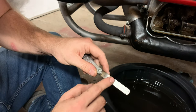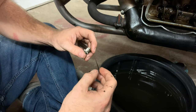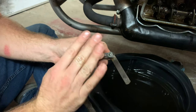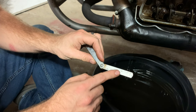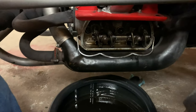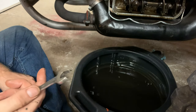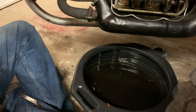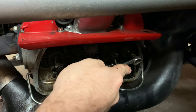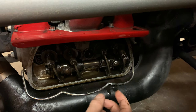They build oxidation on them and it gets thicker. We're talking about four one-thousandths of an inch right here, so you can see how flimsy that is. If it has a layer of rust on it, the entire measurement is botched. This one's actually not too bad — it's pretty clean, so we should be pretty good. If you had a Brillo pad you could smooth them up, but the problem with that is you're actually taking material off. Just enough to clean them up a little bit — I've seen some that were pretty rusty that guys were using.